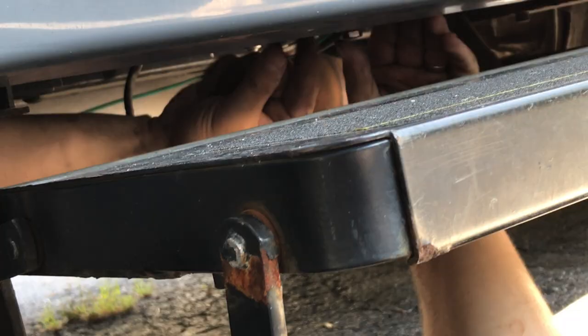Okay, so the hardest thing so far was probably pulling the cotter pin and the little pin that I showed you out of there, but a pair of needle nose pliers will set you up. Also, another thing that you should know is that the four bolts that are actually holding that gear mechanism up there are 11 millimeter instead of 10 millimeter.